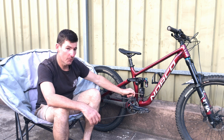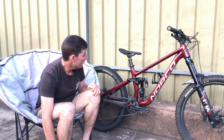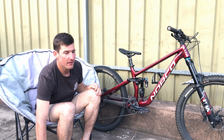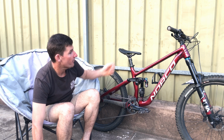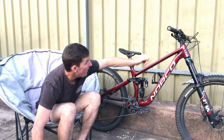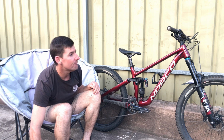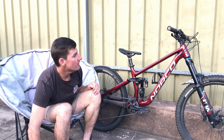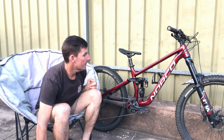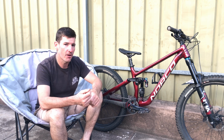Yeah, I'm stoked I got this thing working, because when I got it, it felt like a bag of bones. It just didn't feel great. And riding it, their recommendation, it's just tall and doesn't corner well and just feels whack. And old mate that I borrowed this bike off of had a low bar height as well. I've got that bar height at, if you measure off the ground, 1065, I think, to the top of the grip. Yeah, it's between 1060 and 1070. He had it at 1040, which is too low if you want to have fun on a bike.